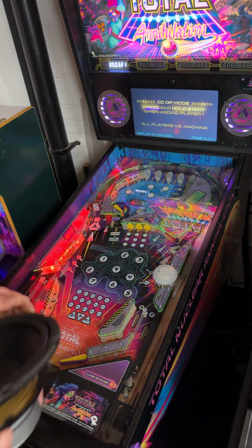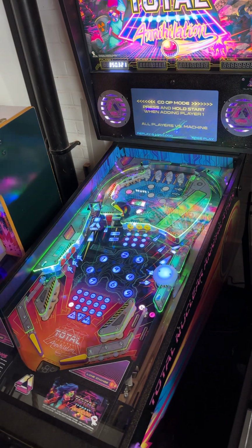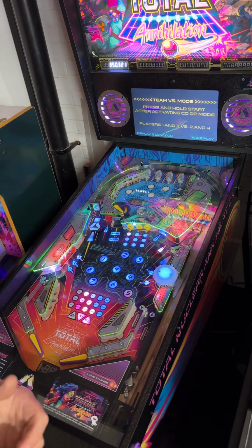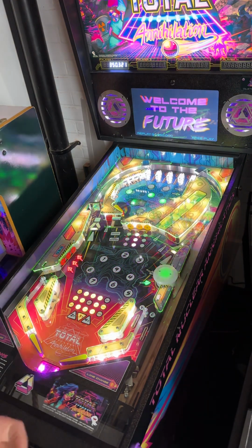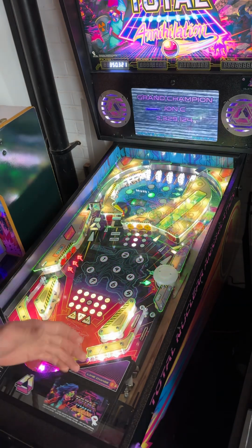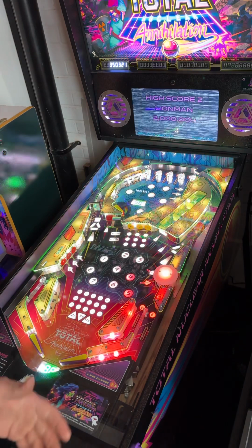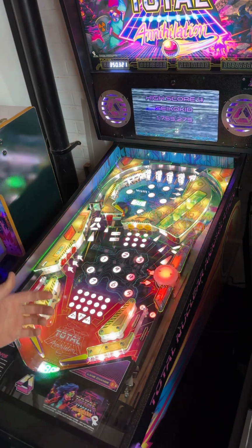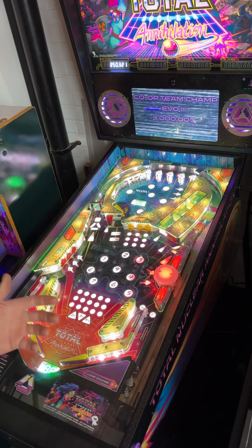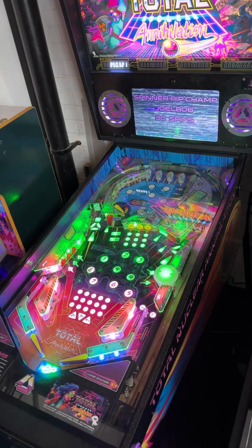Another thing that I'm playing with is the ports. I've got one port blocked at the moment, just with a tissue. I can't seem to find a good 2-inch plug, and it does change it. It sort of flattens out the bass when you have the ports open. I'm picking up far more than was intended frequency-wise. If I have both ports blocked, it's pretty strong on the bass.